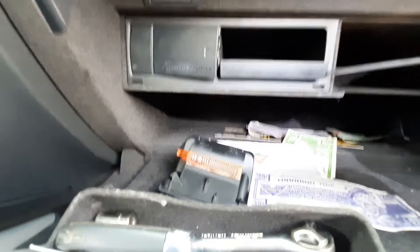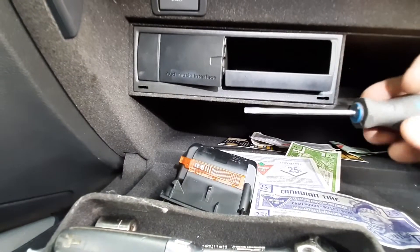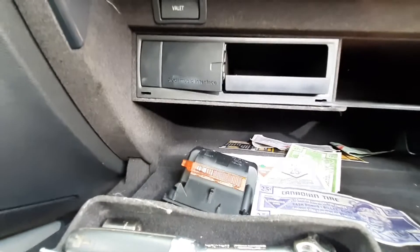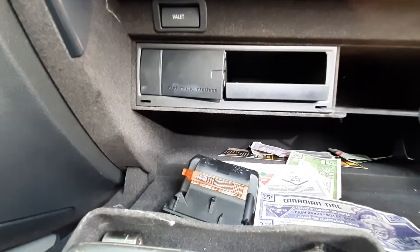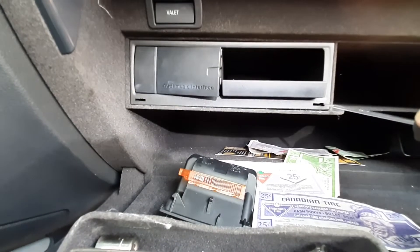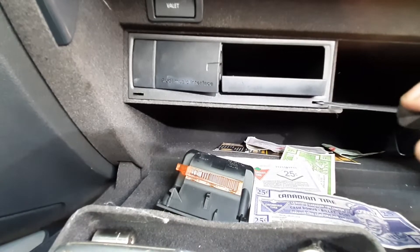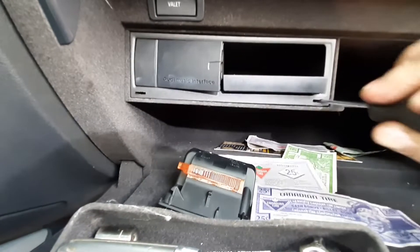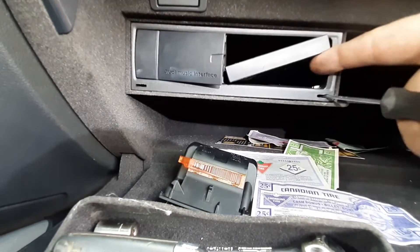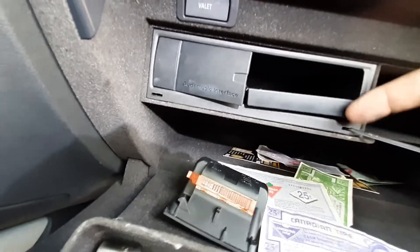Anyway, it's hard to see on video. I'm using a really thin flat blade, very small. And if you look in the slot, about halfway here there is a tab. If you look at the special tools, they get narrower as they get to the top — the angle goes that way. So you push it in here, you want that tab to move. On this side I can actually show you what's going on — that metal tab is coming up. You won't be able to see it on this side, but that's the same idea.